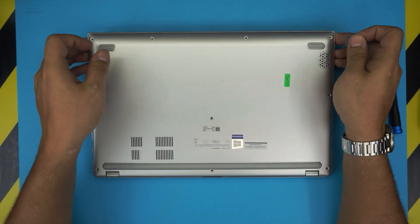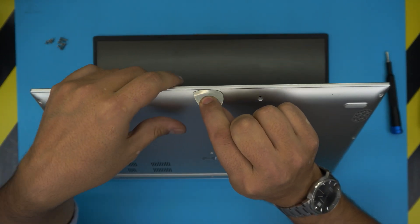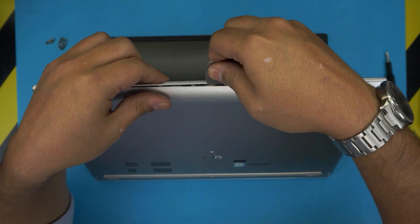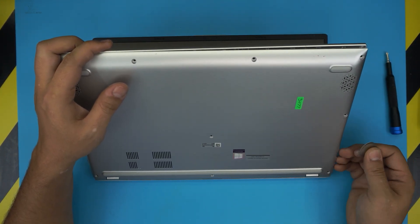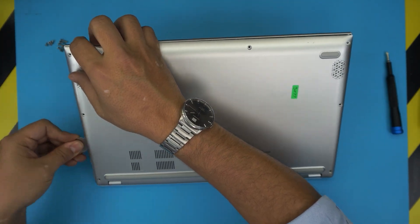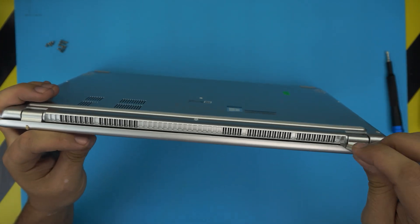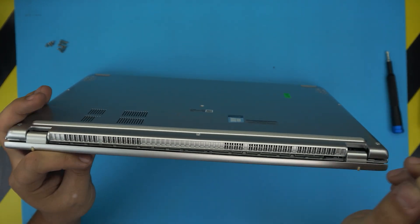Once you remove those four screws, there are no more screws. Open the laptop to a 45-degree angle, grab your opening tool, and stick it between the top and bottom cover. Find your way in and stick it about one to two millimeters inward. Once you have it in position, twist it toward the screen side and wiggle it all around the sides, working your way to the back corners. Once you get to the back, grab the back end at the corner just behind the grill and pop it open. Now bring it down and lift up the bottom cover.